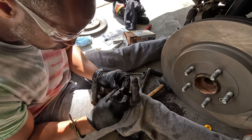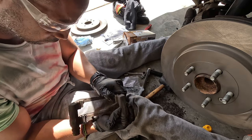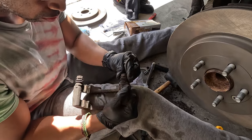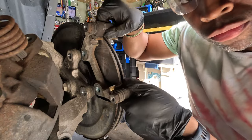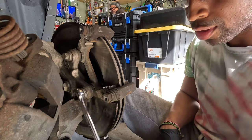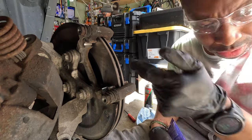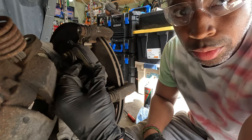Now these are orientation specific, so just be mindful putting them on — actually you can't even put them on the wrong way. All right, got them loaded. One thing I will do is check the movement of these slides. Even if the slides are moving well, it's a good idea to remove them and apply fresh lube — I'll link a video in the description. These seem to be moving okay so I'm going to throw everything back. I also apply new lube to where the pad and the hardware touch — just a very little bit. I also put a little on the wings, or whatever they're really called, where the pad slides in. And now I'm just going to slide the pad in.